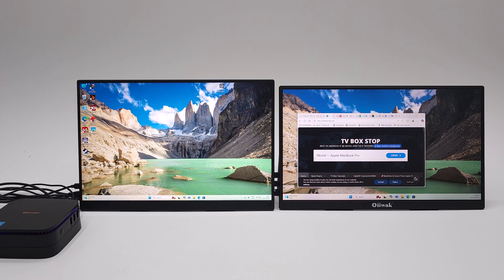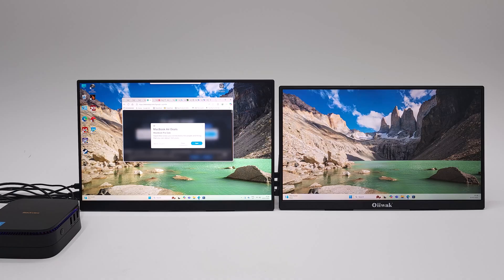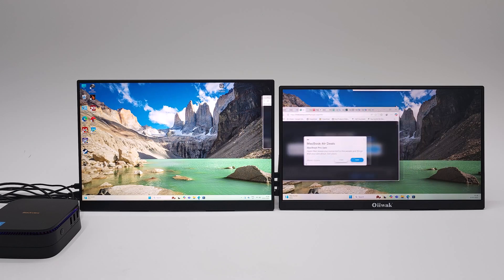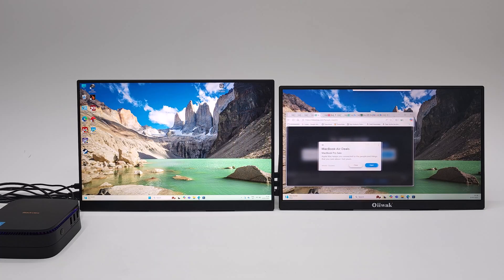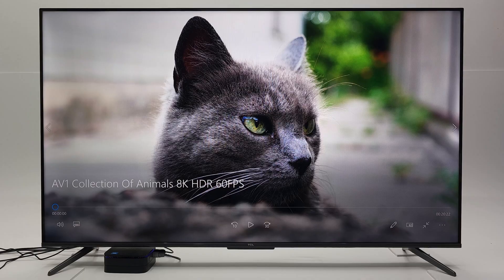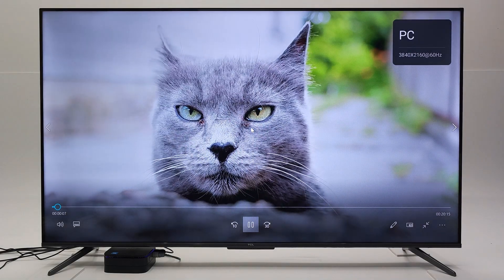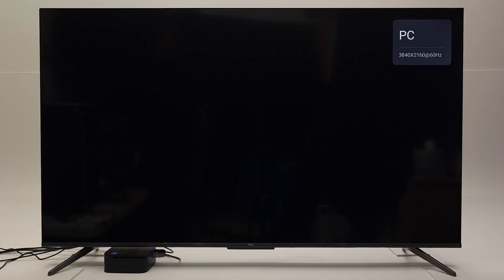You get dual monitor display support, though it does not have a USB Type-C display port or DisplayPort 1.4, so you are limited to dual displays. It features 4K HDR display; however, Intel CPUs used in these mini PCs do not allow dynamic HDR switching or auto HDR. You can use shortcut keys — Windows key, ALT, and B — to toggle HDR on or off. With mini PCs, you don't get HLG or Dolby Vision.